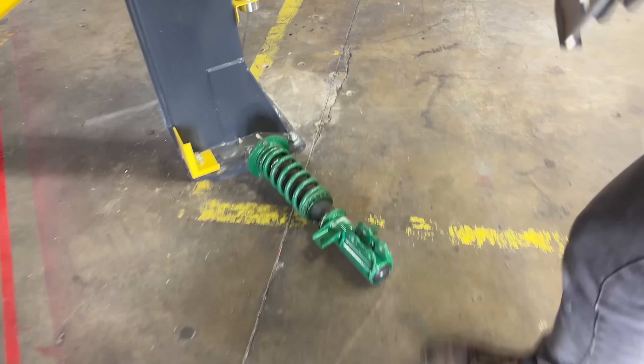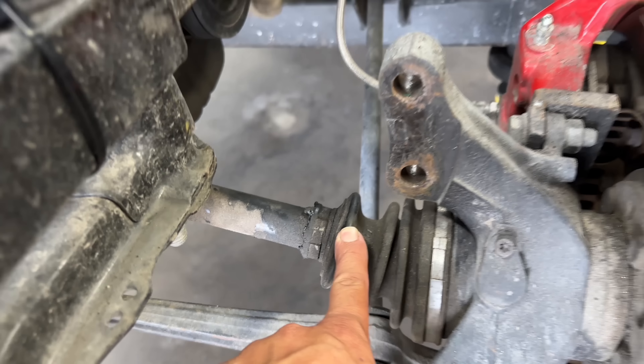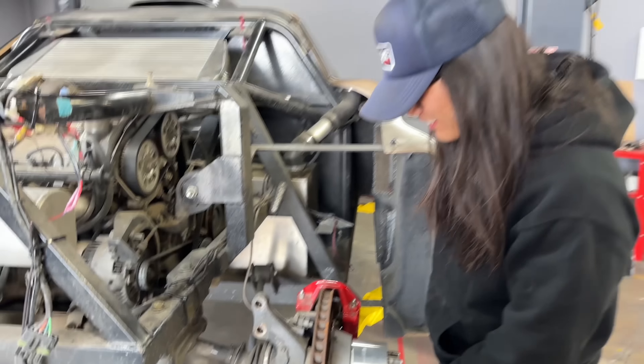The bottom of the shock is sticking out and it was almost touching the boot on the axle, but the car was still pretty high — there's a pretty good wheel gap. So we'll pull the shocks off, chop these things off, and grind it all smooth. But before we do that, we need to measure the distance to the center of the bolt hole so we know where to put the other one and don't have to figure that out later.